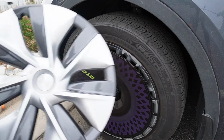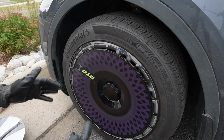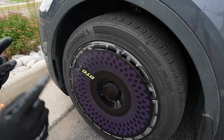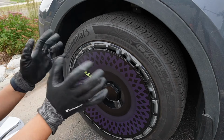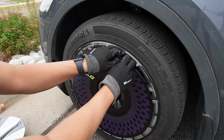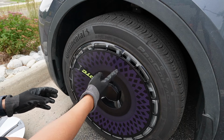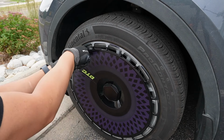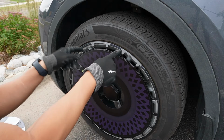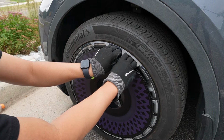back to the Gemini wheel covers, let me show you how to remove the Aero disc style wheel covers. So first, I would recommend wearing work gloves and then put 2-3 fingers in here. Find the spoke of the alloy wheels where the clips are. You see those clips go in between the spokes. So grab hold like this and then pull it towards yourself.